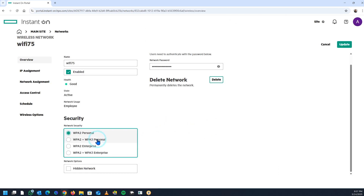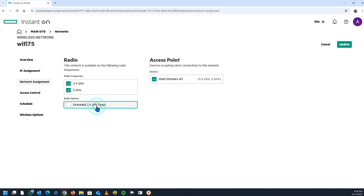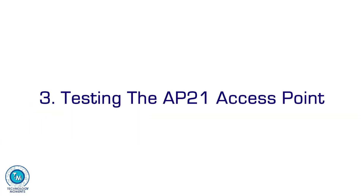We will have our access point ready to accept concurrent connections. You can create any additional networks if necessary at this point. If we want, we can configure parameters such as the bands to use, their security, and change the password. We can use this option if we have remote clients using, for example, the 2.4 GHz network, such as IP cameras and smart devices. In short, we'll have plenty of control — and most importantly, very easily.